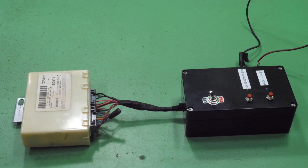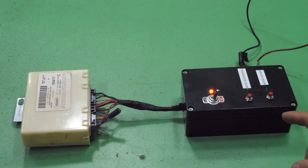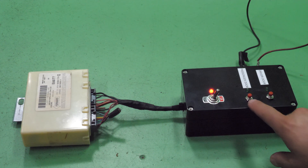We replace the relays and we test them with this testing rig that we built here. Now that the testing rig is on, I'm going to signal the passenger door to open, and you'll be able to hear the relay click and you'll see that light illuminated right there.